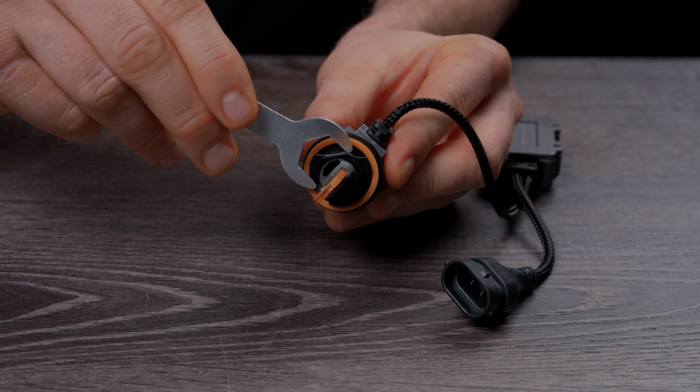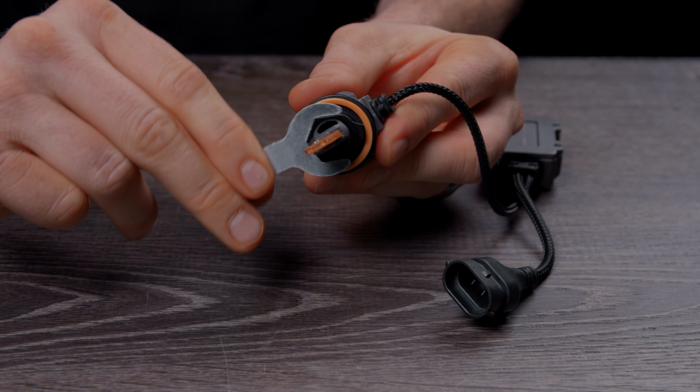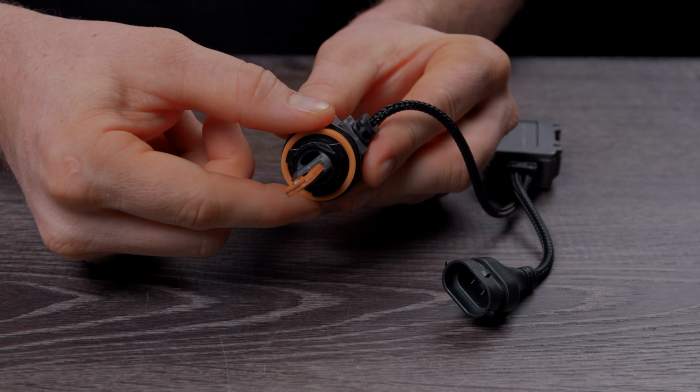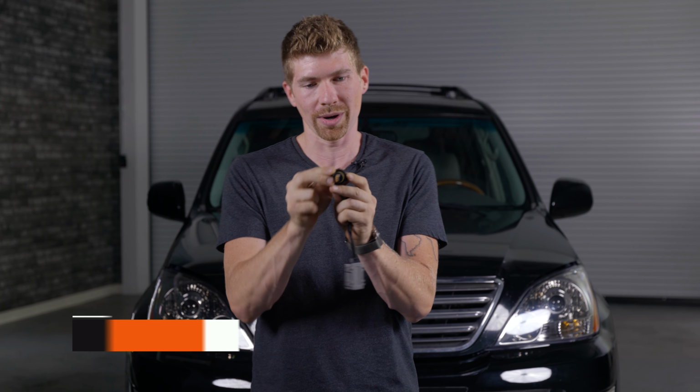When you install these bulbs, I still recommend adjusting them. Thankfully, the 4.0 is adjustable. Take the included wrench. We're gonna put this here, and then we're just gonna loosen up this collar that's on the top. And then what you wanna do is adjust this and rotate it so that when it goes into the backside of that housing, it sits up like this at the 3 o'clock and the 9 o'clock position. You don't want it to sit like this.